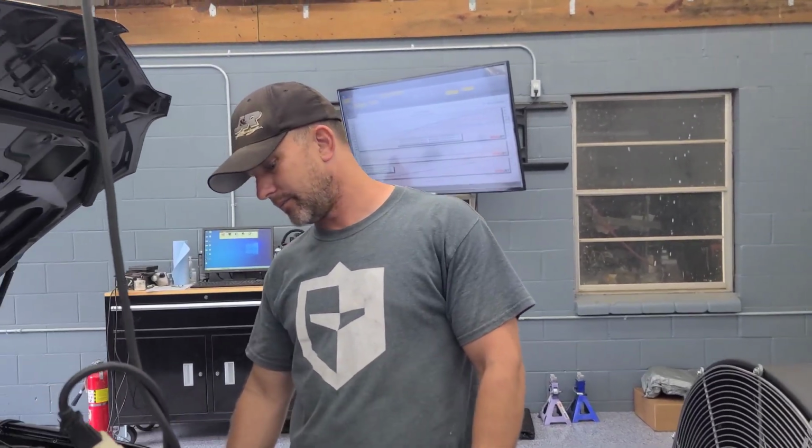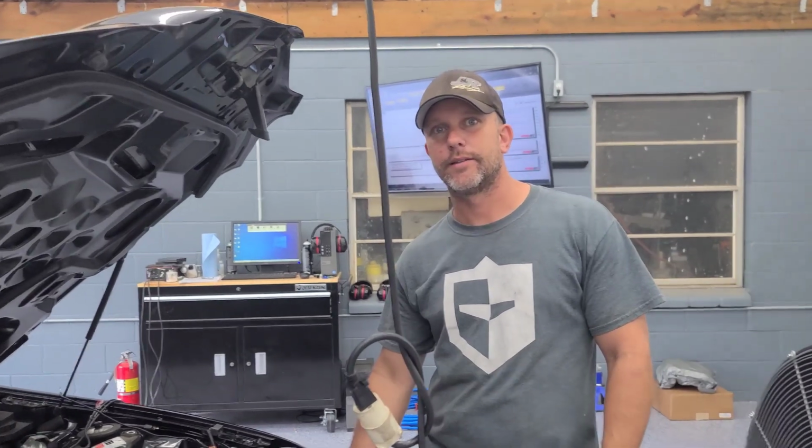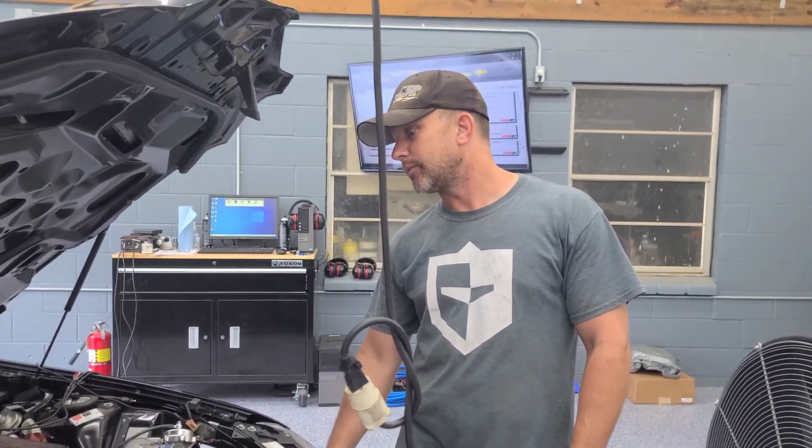I take the over center spring off the clutch. It gives you a steadier pedal the whole way through instead of feeling like that over center at the top. Some people like it, some don't. Of course, I made it so he can put it back in if he doesn't like it. Before it was like a light switch. He said his wife wouldn't drive it because it was like an on and off switch. I believe it. It was pretty terrible.